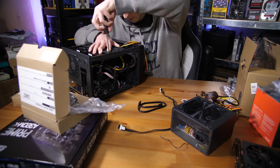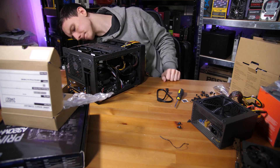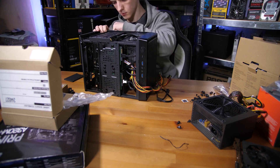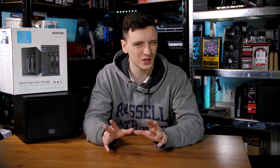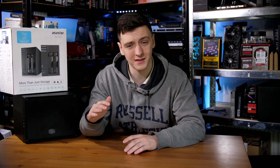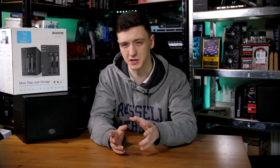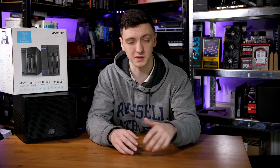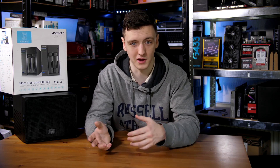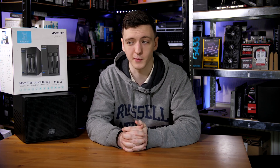When it comes to the power supply, this is generally going to be a pretty low-wattage unit. As long as it's a relatively name-brand power supply you should be okay. I'd personally recommend 300 watts or up, just in case you want to add extra features. With an A8 chip and basically nothing else you're probably only drawing 50 to 100 watts from the wall, but you still want some redundancy as power supplies degrade over time.